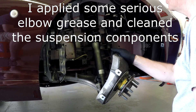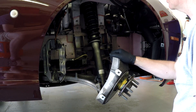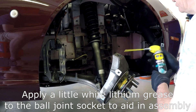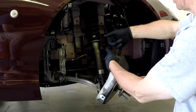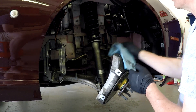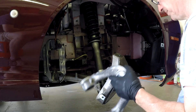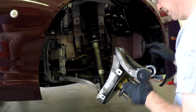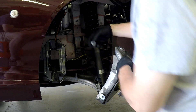I've taken a few minutes and cleaned up the socket where the upper joints go in and the front spindle assembly. We're going to start putting it back together. First I'm going to use a little white lithium grease to lube up the socket where the ball joint goes in - more for corrosion protection than anything else, so next time if it ever has to come apart it won't be seized. So I've got my control arm, I'll pull off the protective cover, and gently set it in. It's tapered so it fits. I've also made sure I'm putting the right-hand one on the right-hand side - they do only go on one side.